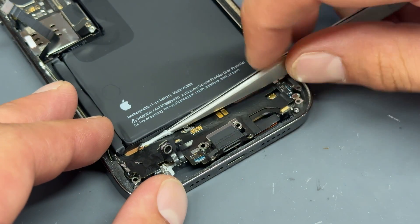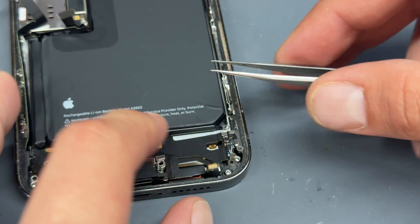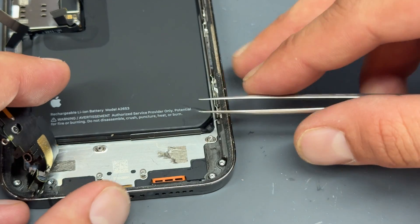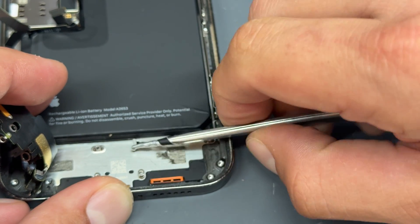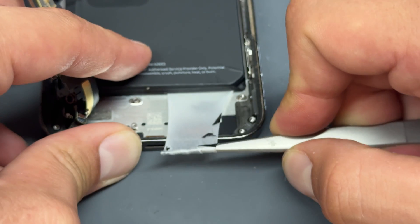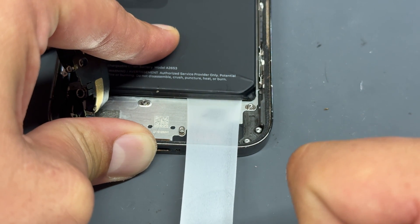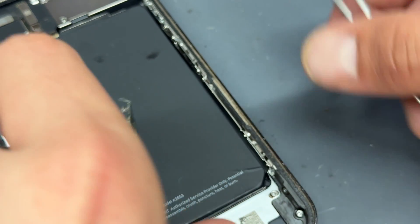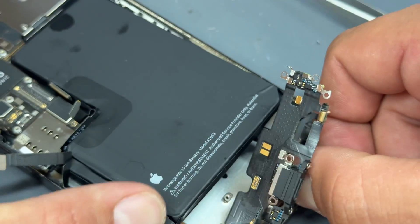It's a pain — it's difficult. Just try your best to pull it out. For the other battery tab, hopefully this one comes out a bit easier — notice I'm wiggling it from side to side, which makes it easier rather than just pulling it. That one wasn't as bad. And then for the rest of it, there's just a tiny bit of adhesive up the top. Add a couple of drops of isopropyl alcohol around that, and then carefully with a plastic tool from the bottom, just lift it up and you'll notice it comes out very, very easily.